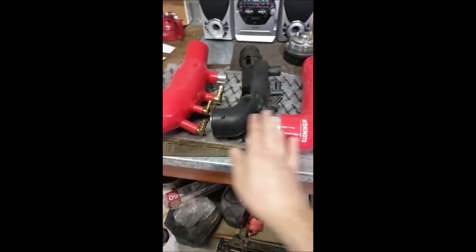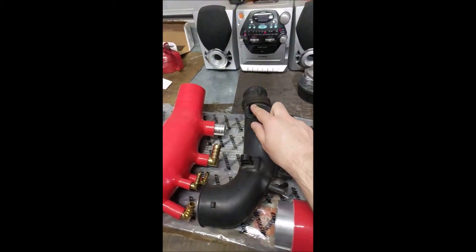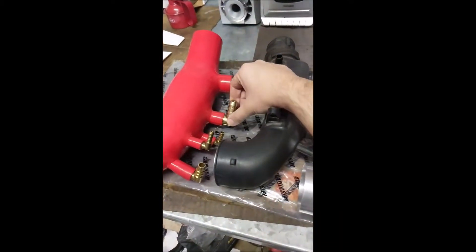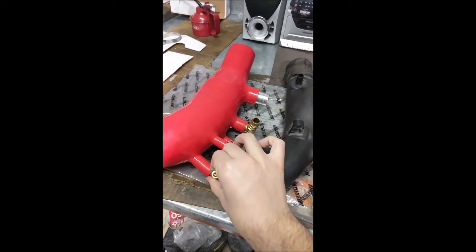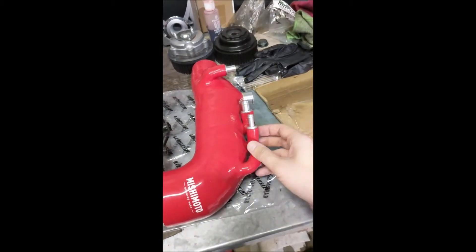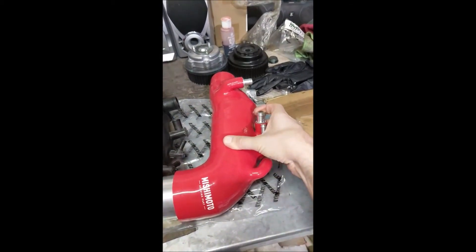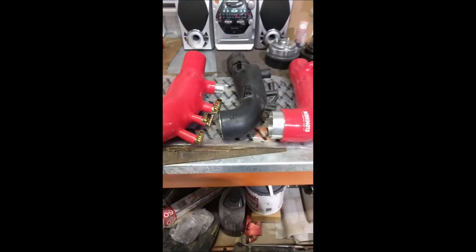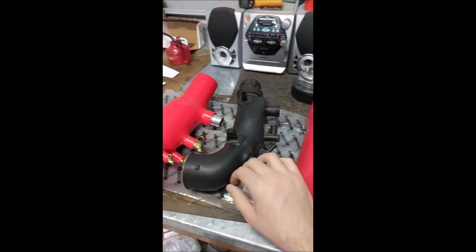So that's a quick comparison between these three turbo inlets. If you're going to get one, pay a little bit more and make sure it's got the pipe at the top. If you're fussy like me and want your hose connections to stay factory, also find one that's got brass fittings that can swivel — that swivel feature is really good. Also make sure the bypass valve connection is just a piece of pipe, not molded in. The semi-fixed fittings on the Mishimoto are a bit of a drawback, so if you're running custom catch cans and similar setups it may not be suitable. Look for brass swivel fittings and you'll be right.